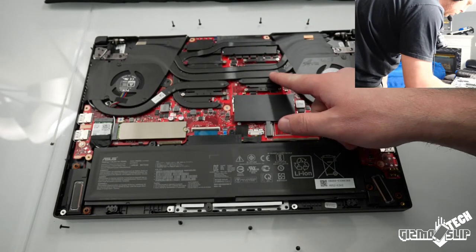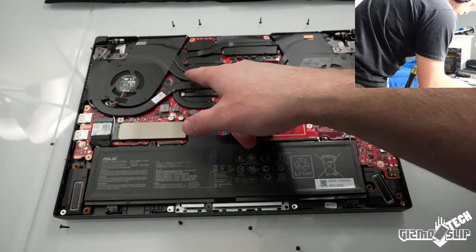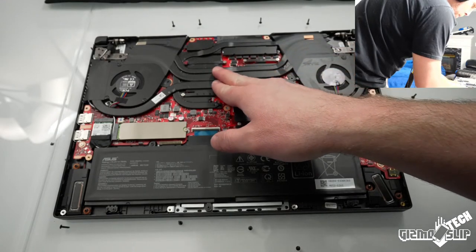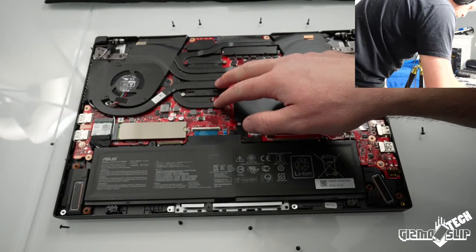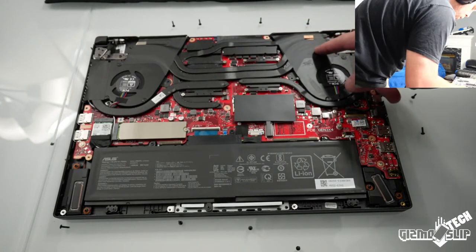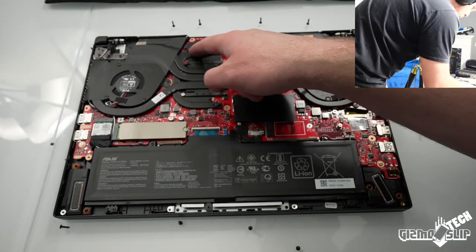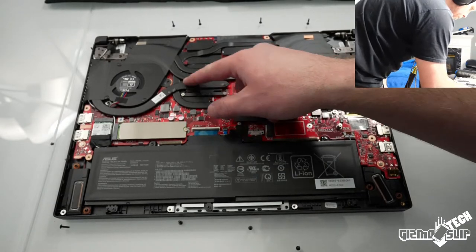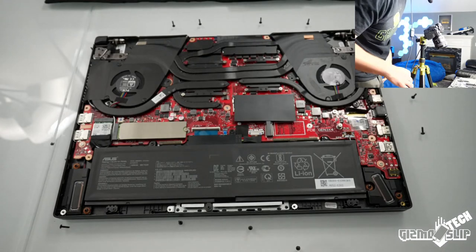In particular, if you're just doing CPU only loads, you're going to be able to access both fans really well. The GPU has three shared heat pipes. Two shared heat pipes, and then one dedicated to this side and one dedicated to this side. So if you're doing a GPU only load, you'll at least be able to access both of the fans somewhat. Now this one goes around the VRMs. This one goes directly to the GPU cover basically. So this is where the main ones that'll take most of the heat off.